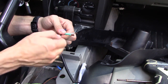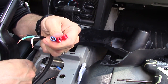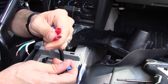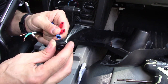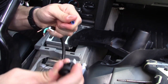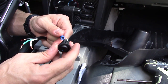Let's twist that up. Next, on my switch, I'm going to use these quick crimp-on connectors. The blue one is going to be the ground wire and the red is going to be the hot — the voltage wire. They just slip on right here on the connector. The reason you want to use these connectors is because anytime you want to remove your paneling, this will actually unplug and you can remove the paneling — it's not going to be a pain later on if you need to do another installation.